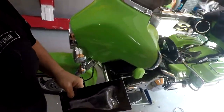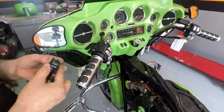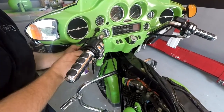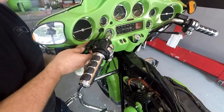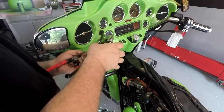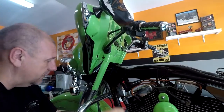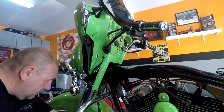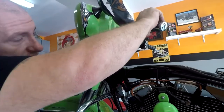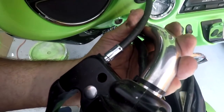I ended up getting the brake levers and clutch lever — pretty cool, I like them, they got a little slot in there. I'm gonna put the cable through first, pin goes through, make sure it's all lined up. Now we gotta put the pin on, and then the retaining clip — that's in. So I'm just tightening this cable up to get about an eighth of an inch play between the housing and the cable. Once you're done with that you gotta tighten the lock nut, then put the boot right over everything. I've done it so many times I just do it by eye — cable from the housing should have an eighth to a quarter inch of play, and I'm right there. They fit pretty good, these handles.